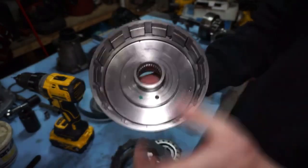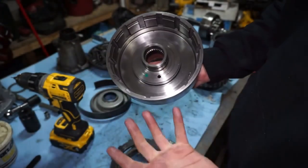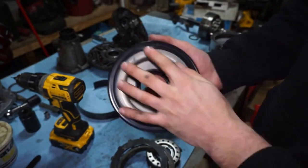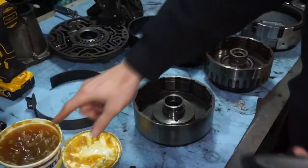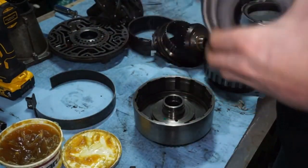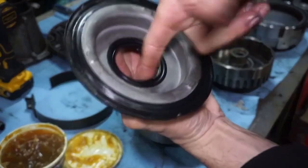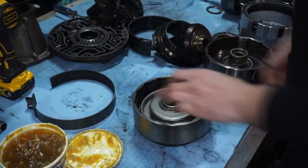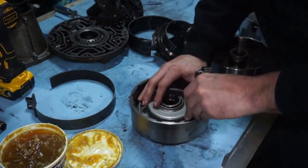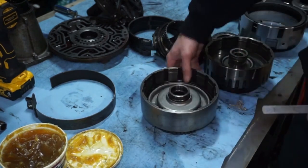This lip seal is taken out because it's part of the dual feed mod. It basically fills here and here — you take the seal out and it applies fluid on the entire piston, whereas the normal apply is divided by the lip seal. When you take that out, it applies on the whole piston so you get more clamping force. First I'm going to take some assembly lube, put it on the lip seal, and put some inside the drum. Put some on the inner lip seal also. Then we can drop the piston into the drum — I'm just going to use a feeler gauge and go around the lip seal to tuck it in. There we go, the piston just dropped right in.